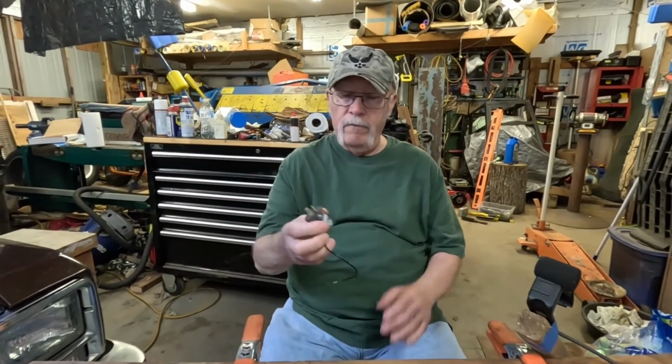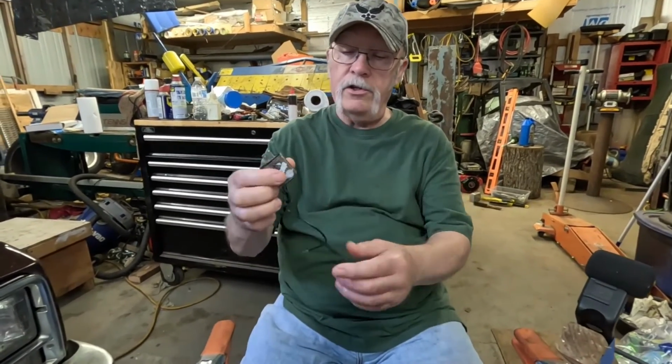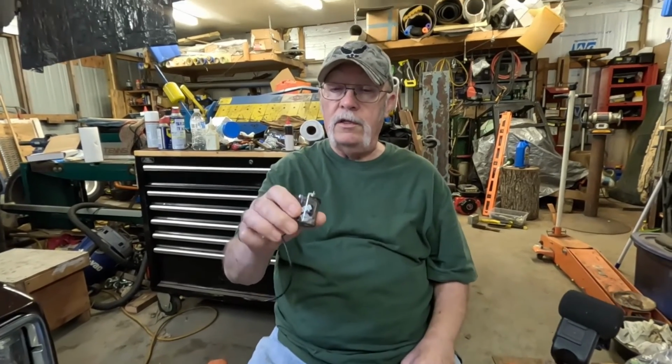And then we used the flasher. Well, the Valiant has a 3-prong flasher, so it doesn't have this extra grounding tail on it. So it just went in, and then the wiring harness, you have to put a ground from the wiring harness, but it was easy, and everything works so well, and they're nice and crisp and bright.